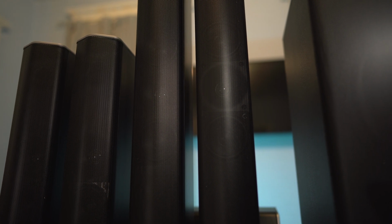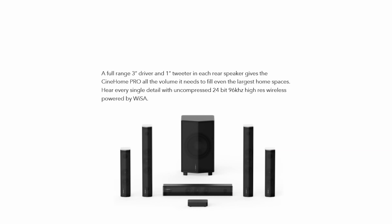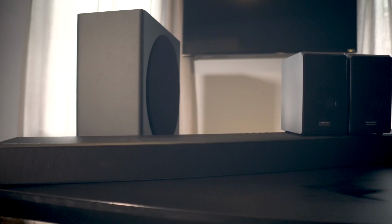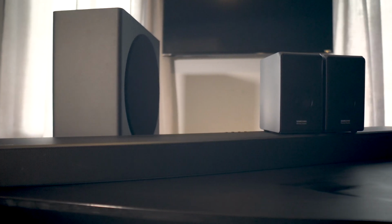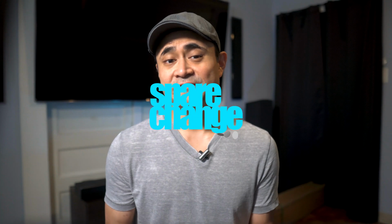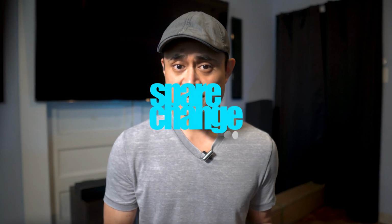This is a nice handy little home theater. For those that don't know, it runs off of WiSA, which stands for Wireless Speaker and Audio. The Cinehub will send uncompressed 24-bit 96K high-res audio to each one of the individual speakers in its own 5 GHz wireless network. Sound quality-wise, I found the system could outperform many of the soundbars that I've reviewed. You could find those reviews on my personal channel, Spare Change, and be sure to subscribe there if you haven't already.